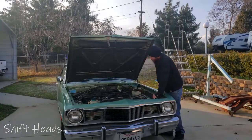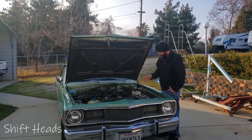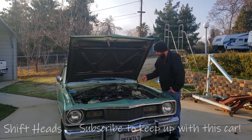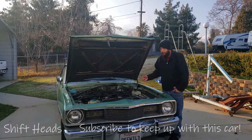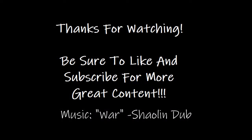I think what we can do today is send power directly to the starter from the battery, but leave the power going to the main harness — which is what you're seeing — off. Then we can run a jumper wire to the coil, and I can jump the starter, so we can at least get this thing running to where it's easy to move and we don't have to push it. We'll see you in the next video.